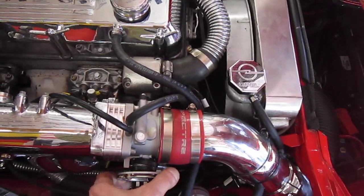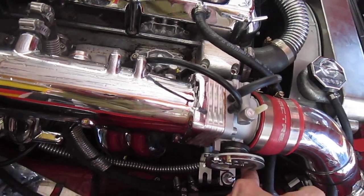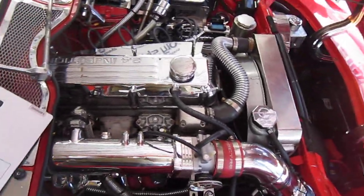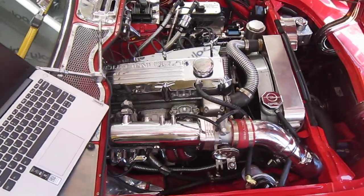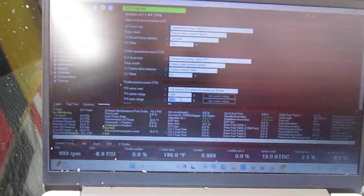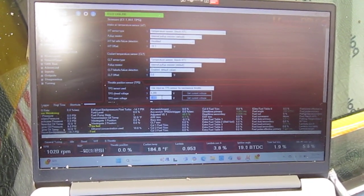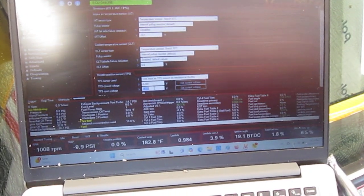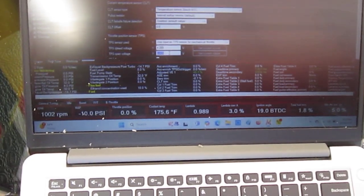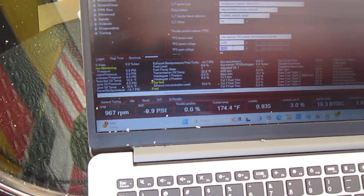It's not quite so easy to rev it. I just got this running about an hour ago, did some tuning and stuff like that. That's the Max ECU operating system. Along the bottom there you can see my RPMs. My idle duty is running at about 5-6%, and my RPMs are set for about 975 to 1000.